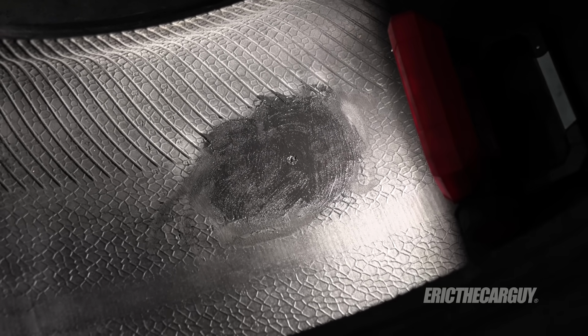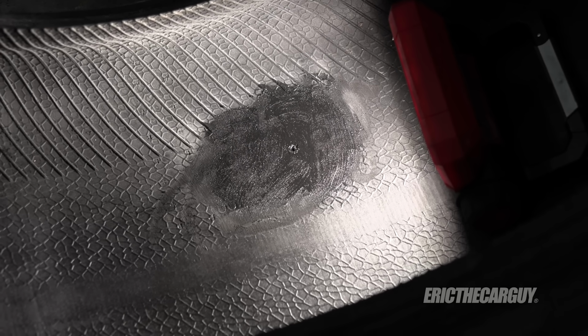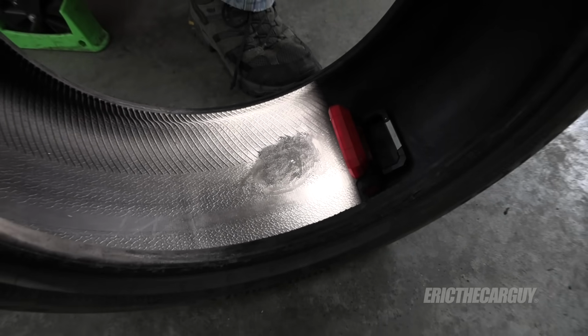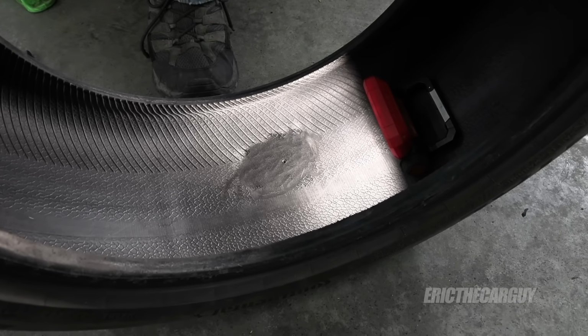You let it air dry. And in the instructions, it's kind of weird because what they say is the fumes from this apparently will sit all down in the tire, so they want you to turn it upside down, which I'm going to do anyway to install the patch, but they do mention doing that. Now that it's dry, it's time for the next step.